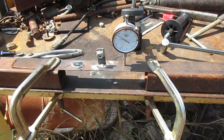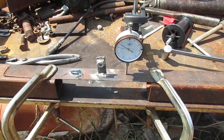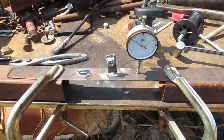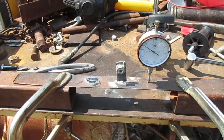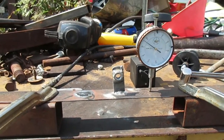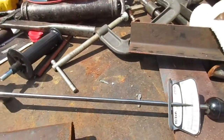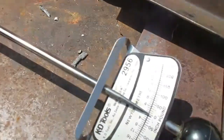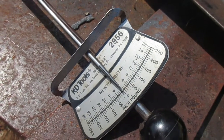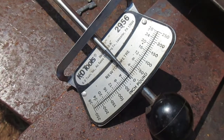What I'm going to do here is prove a point about axle wrap and over-slung and under-slung suspensions. I've welded a piece of scrap with a bolt tacked to it, representing an axle, and another piece of scrap representing a spring. I'm going to apply torque in two different directions using a beam torque wrench set up in inch-pounds, applying 50 inch-pounds to either side to simulate what we're talking about.